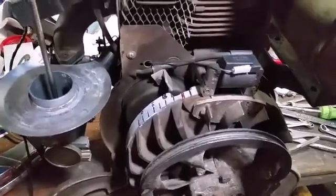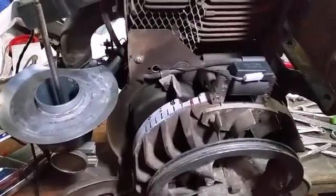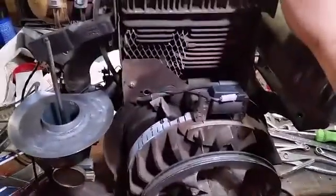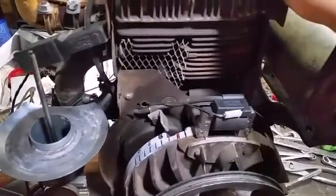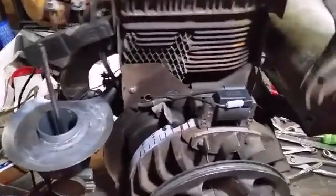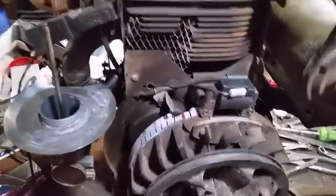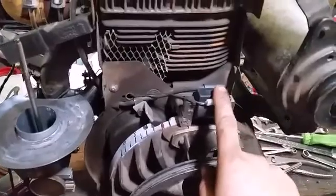When I had adjusted the carburetor on that aviation fuel, I noticed it was pinging — you could hear almost like a second exhaust note before the exhaust stroke. It was a very eerie sound. When it would get up to three quarters of the RPM without a load, I imagine under a load it would probably stop pinging, but that's hard to say.